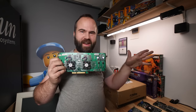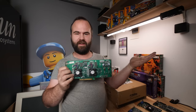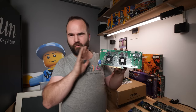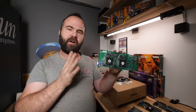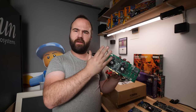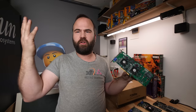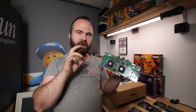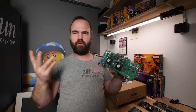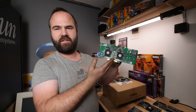In my opinion, this is just for older games and older CPUs — go for Pentium 3 era systems with this card. For the Voodoo 4 4500, I'd recommend a Pentium 3 500 MHz up to Pentium 3 1000 MHz. I combined mine in a similar system to the Ultimate Year 2000 build with the Pentium 3 1 GHz and it performs well — just at a little bit lower resolution, with similar frame rates to the 5500 at higher resolutions. Pentium 3 systems are really good for the higher-end 3DFX cards.